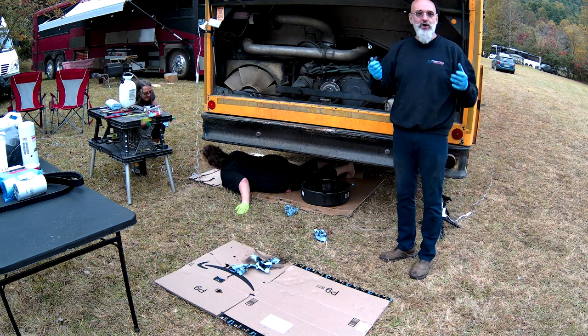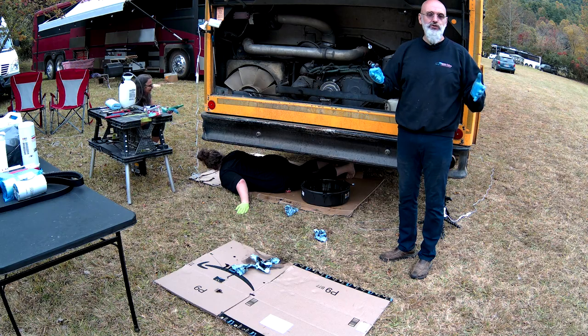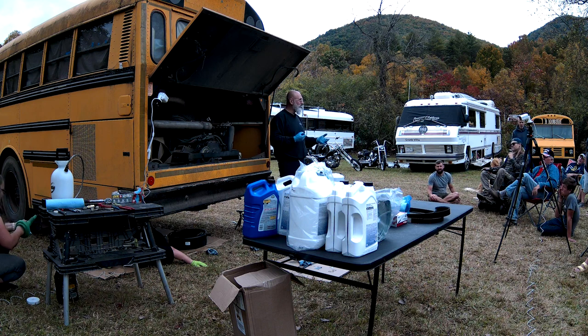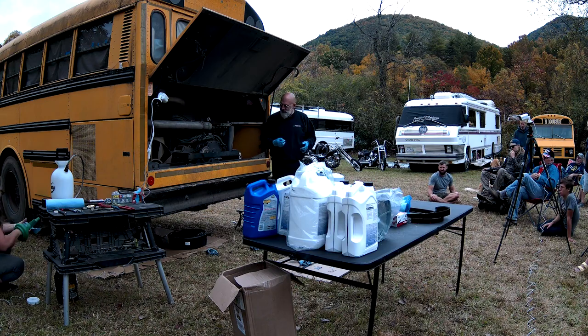And like I said, do an oil sample every time. It costs 20 or 30 bucks, and it will warn you of an impending problem. Maintenance is a heck of a lot cheaper than a repair. So are we still dripping down there?